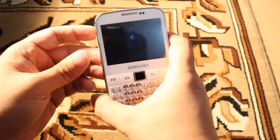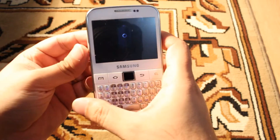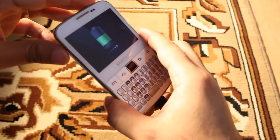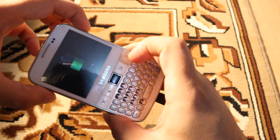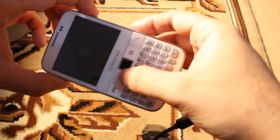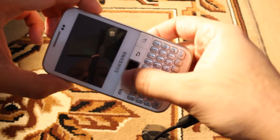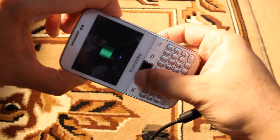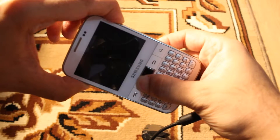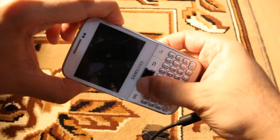It's very important — do not do this without charging your phone properly. After that, you have to hold the power button — the power button, the volume up key, and the home button, all three buttons together. Press until you see the Samsung logo.